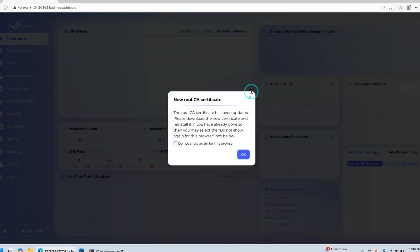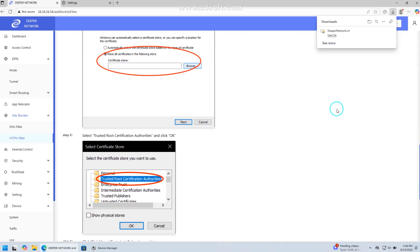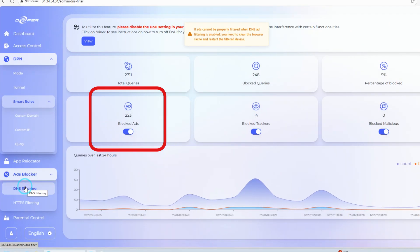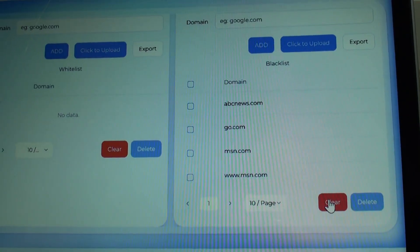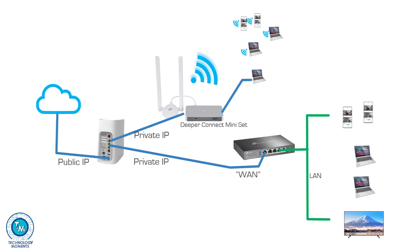You can configure this device by having access to its Atom OS interface, which is very clean and will very easily tell you the steps you need to take in order to have full protection — like disabling Safe DNS and installing the certificate. Both are needed so all traffic can be inspected. The ad blocker is just fantastic. Only a couple of minutes after configuring the device, you'll see it in action — this was just after opening a few popular news portals. Parental control has options many parents are looking for and actually worked as expected, with the same options available for blocking social media if you want your network clients to focus on their tasks. The interface is very complete, though still lacking real control over local network IP addresses, the DHCP server, and some other minor services, which reinforces our idea of a mixed network solution.